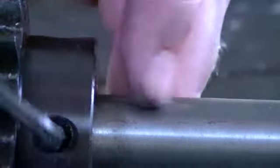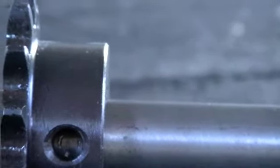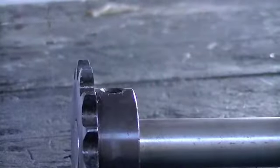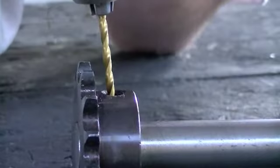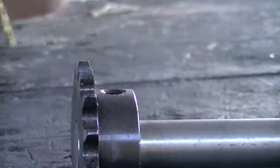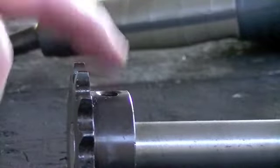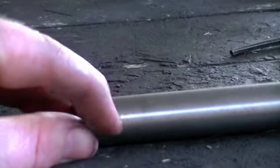There you go. Now you can see this one set screw, and this is the one that we're concerned with. We'll take that out. We'll just use a little small drill just to make a mark. So we'll completely remove these sprockets and then we'll drill onto the shaft. And there again you can see on the shaft my little marks for where I'm going to drill.